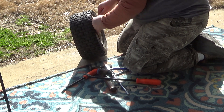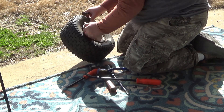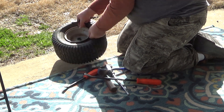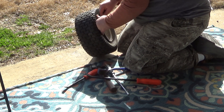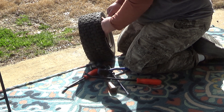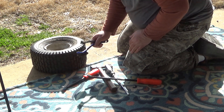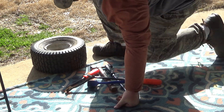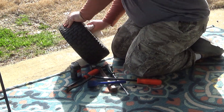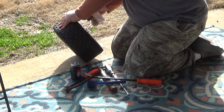Try to make it as smooth as possible. If you're really industrious, remove the rim entirely, strip all the paint, sand it down real good, give it a good paint job. You can do it that way and then you probably wouldn't even need bead sealer. But it doesn't hurt, because usually once these things start leaking they're going to leak for the rest of their lives — new tire or not. You clean it up, it'll last a year or two, but if you put a little bead sealer on there it should last a very long time.